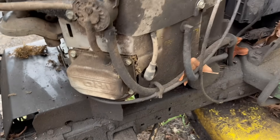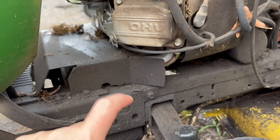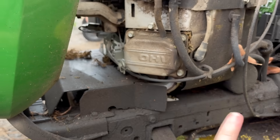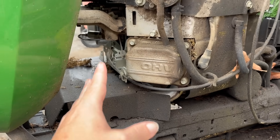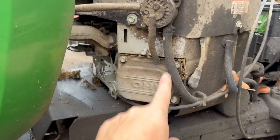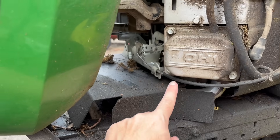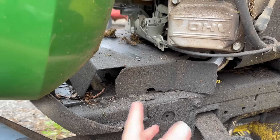Riders are exactly the same as the walk-behind mowers and generators — same issues if you overfill with oil or if your crankcase is full of gas. But there are also other reasons a rider might be smoking. This mower is an oily residue mess — it's got oil leaking from the crankcase gasket, from the seal, probably from the overhead valve covers. We've got to clean it off and let it run before we can actually find everywhere it's leaking from. On a lot of these engines, the overhead valve cover, especially on the V-twins, has a cork gasket on the front, and if these start leaking oil, they will leak right onto your exhaust and it'll smoke.